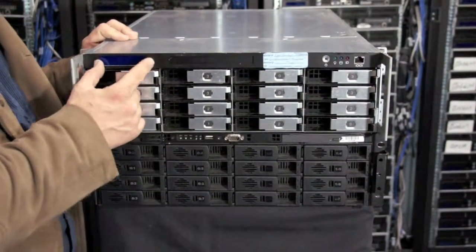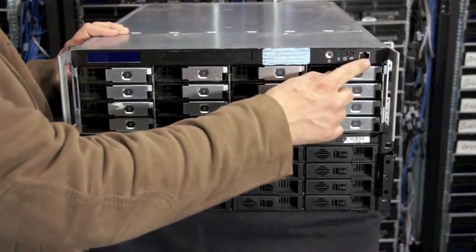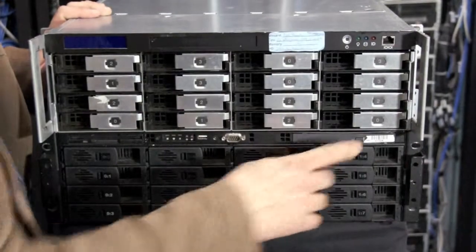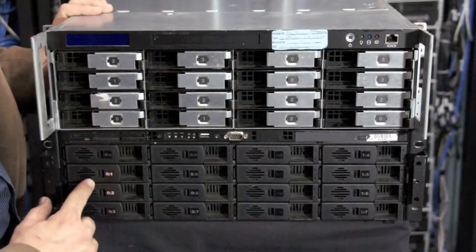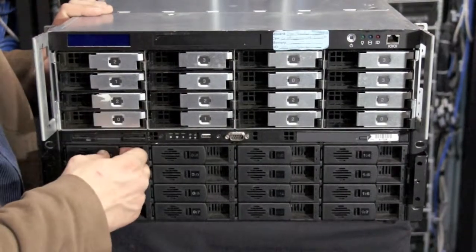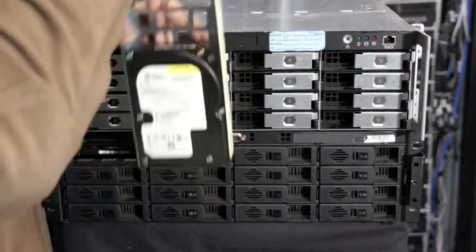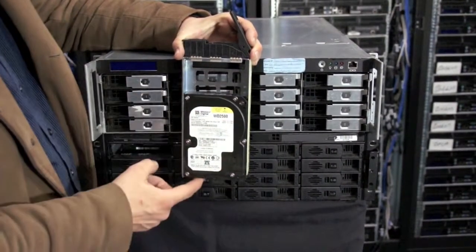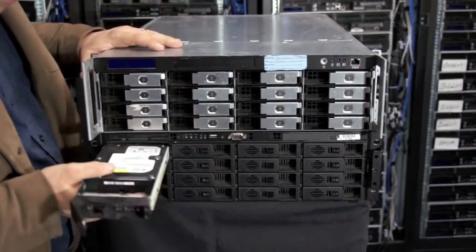The Rackable Systems has an LCD in front, you've got your power switch, and you've got remote serial management. The Pogo Linux has either floppy and CD in front, serial console, and USB for your keyboard as well. Each system has a hot swap bracket. You can pop out 16 drives. This Pogo Linux machine right here has 250 gig SATAs right now. This is a little bit of a deeper bracket to give a lot of good airflow, laminar airflow.